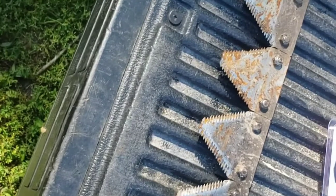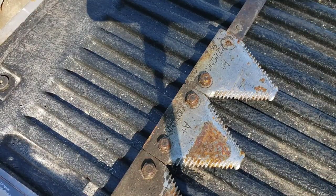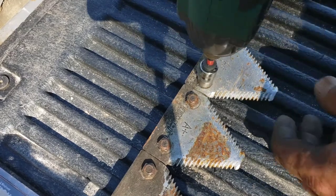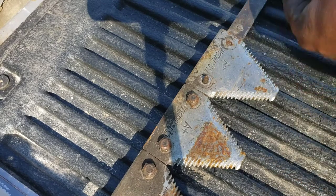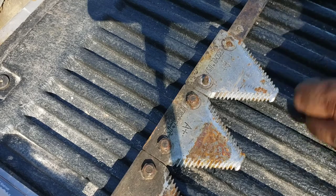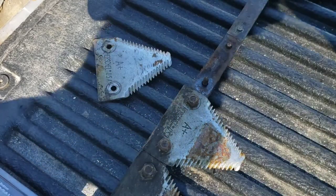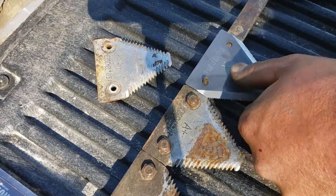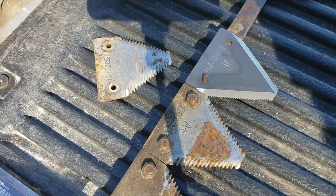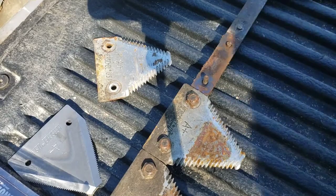We're probably just going to end up switching all these out real quick. Brand new ones. To replace these, I like to use my little impact drill. Just buzz all these nuts off. This one's broken, these are broken - you just pound them back through with a punch. And the old section comes off. You just put the new one on and put your nut back on after I replace this broken bolt.